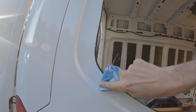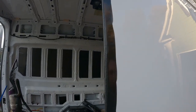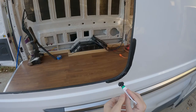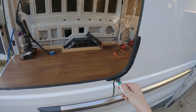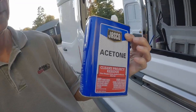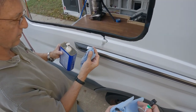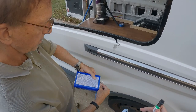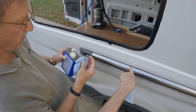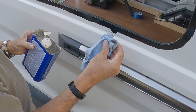Put on your urethane primer. It's just a small tube but there will be plenty. You only need a small line around the metal on the outside like so. Don't push too hard or you'll have drips. Acetone and a rag works to get it off, so you may want to get some before starting the install. I had a few accidents myself that would have left an unsightly mess because it drips black paint fluid down the van if pressed too hard. This dries almost instantly and does not come off with just water and a cloth.